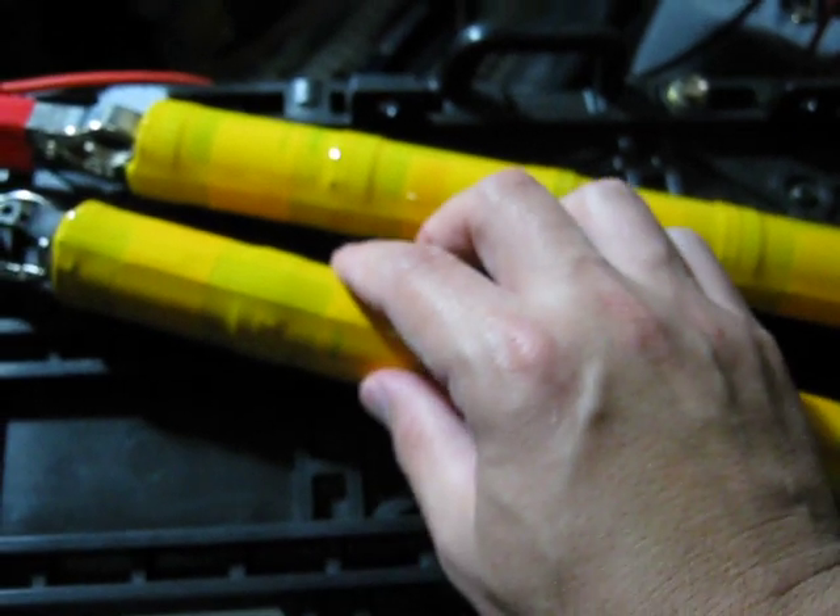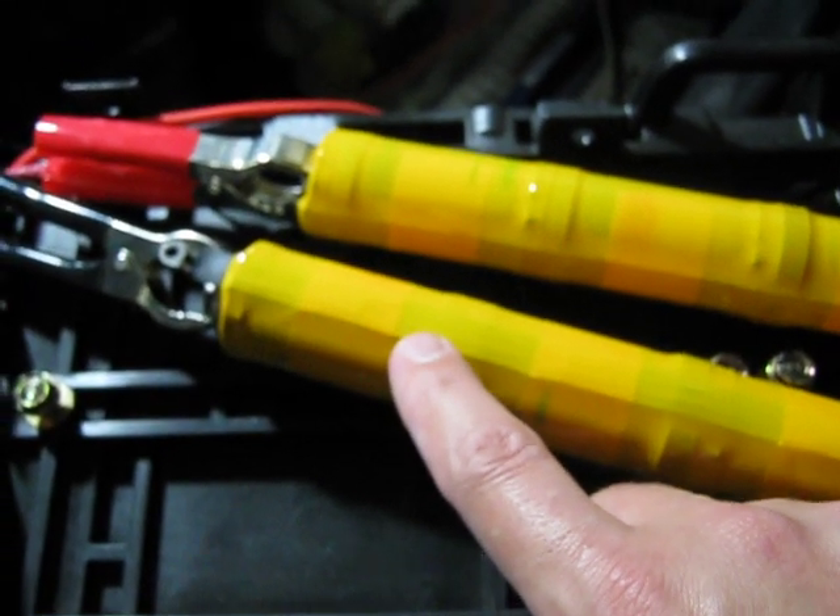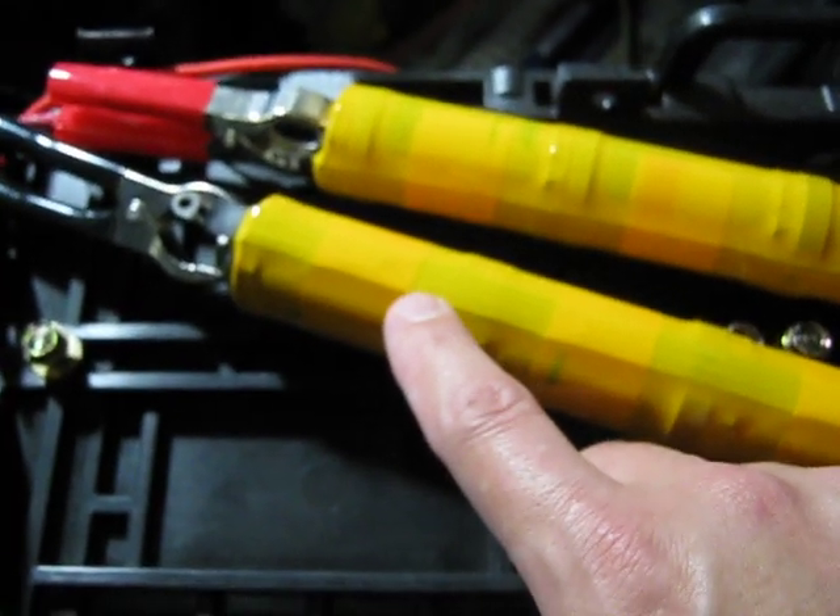Here are the cells. The 2000 through 2006 Honda Insight Hybrid uses 20 of these — we call them sticks, or stick packs. These are D-sized cell batteries, Nickel Metal Hydride chemistry, but they are not like the ones you would put in a flashlight. These are high-powered. I believe they can take a 50-Amp charge and a 100-Amp discharge — don't quote me on that. I just know they're very high-powered.